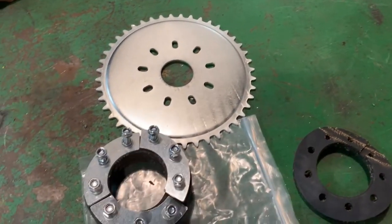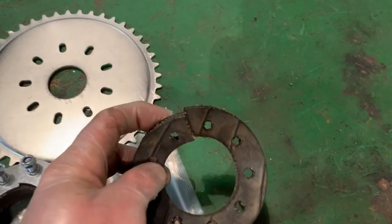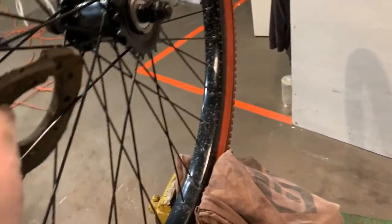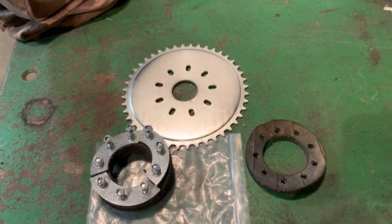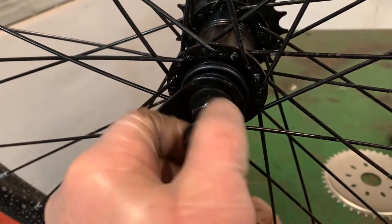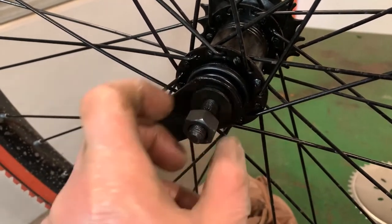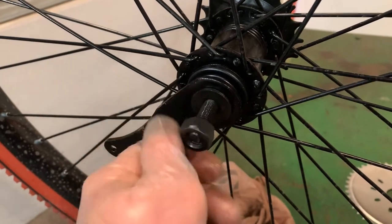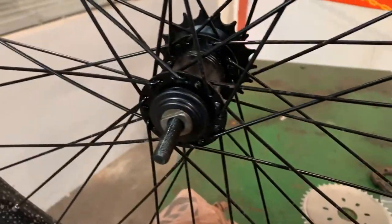To install this I'm going to give you a brief tutorial. You will have to cut one of your rubbers — this one's already been done for the sake of time — so you can get it into and on your hub. To get the sprocket on we'll have to remove this nut, place it on the table, remove the brake arm nut, and slide the brake arm off. Now we'll be able to install our sprocket.